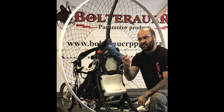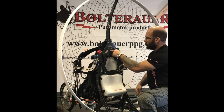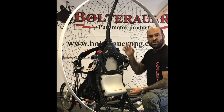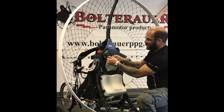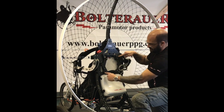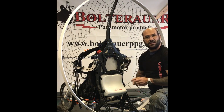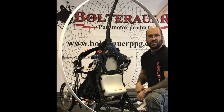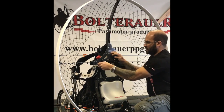Okay, first things first guys, number 6 Allen key, very simple. Step number 1, remove the mounting plate from the actual chassis. It's mounted with 4 Allen cap screws, one situated there, one there, one there, one here. Remember, all the back plates are different based on the different types of engines you're going to be installing, and obviously that the machine's compatible with. This is the Vittorazi Moster 185 Plus.